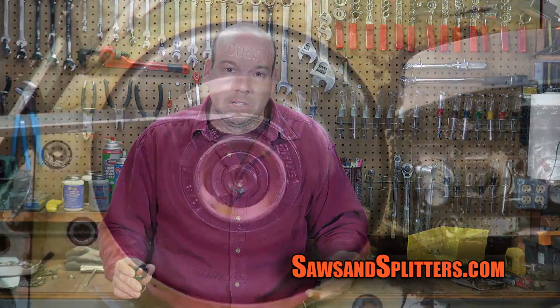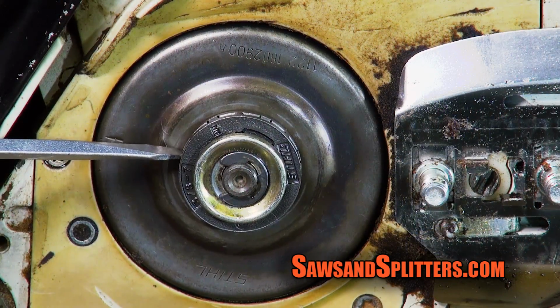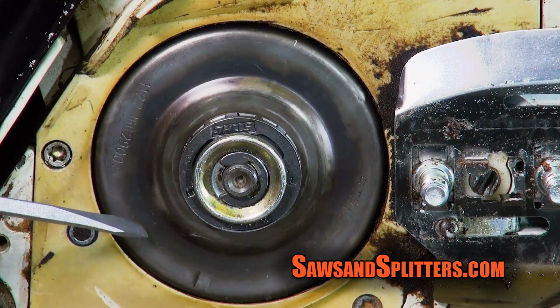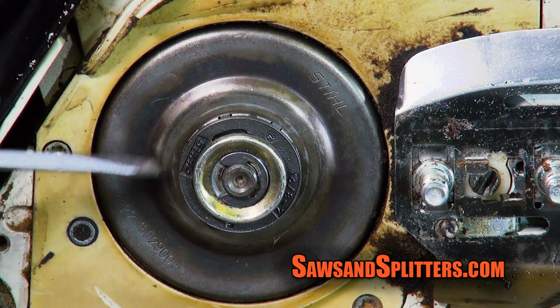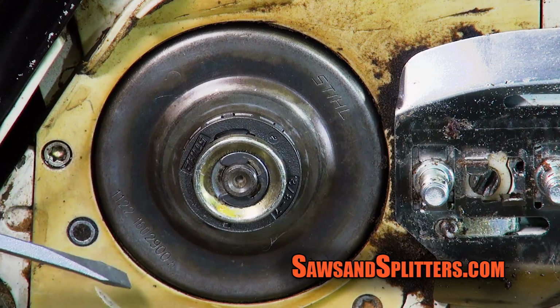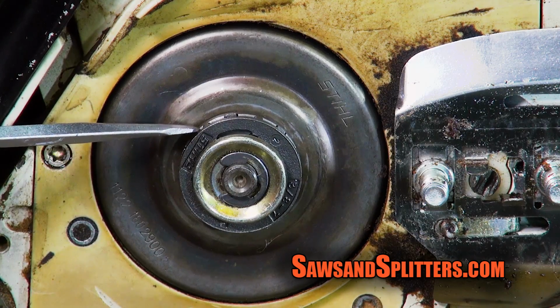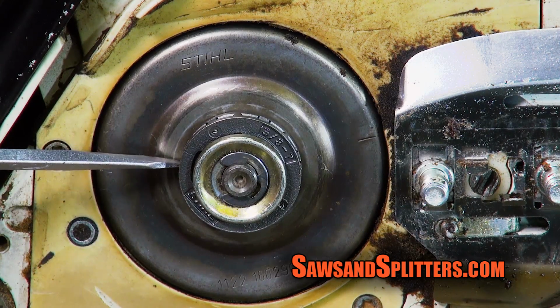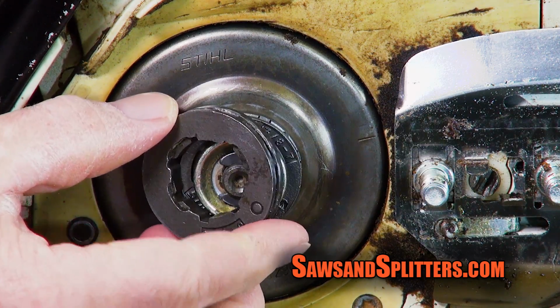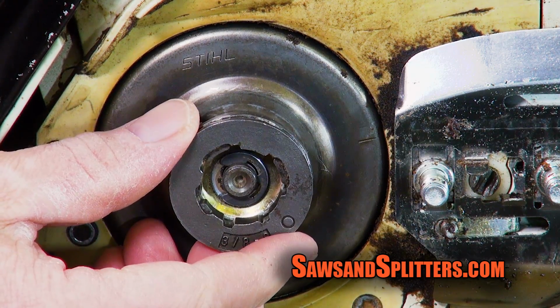And then all that's going to be left on the saw is to tune her up. Right here, this is our new Stihl rim sprocket. And all I got was a new rim sprocket. The fella at the dealer said everything looked good. The clutch looked good. The needle bearing looked good. So that's all we did is get this little rim sprocket. And just for comparison's sake, you see how much bigger the 8-tooth one is?